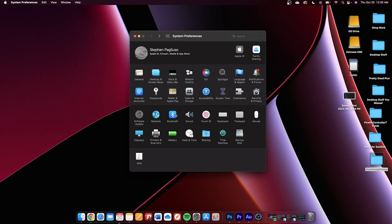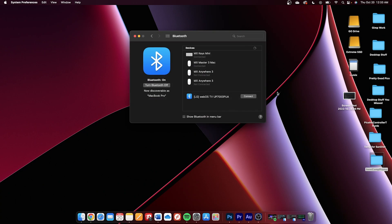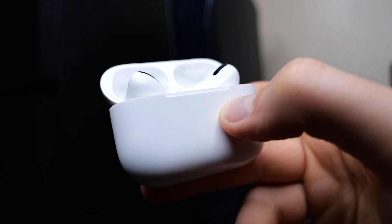If they're still not connecting to your other device, you may have to re-pair the AirPods. To do that, put the AirPods into the charging case, leave the lid open, and press and hold the back button for about 5–7 seconds until you see the front light start to pulse in a white color. Go to the device you want to connect to, and under Bluetooth settings, go to 'Pair a New Device' and select the AirPods when they appear on the Available Devices list. That pulsing white light should go to a solid green light, and the AirPods should connect.